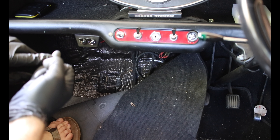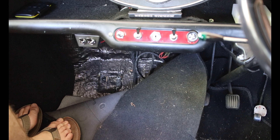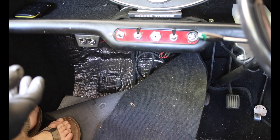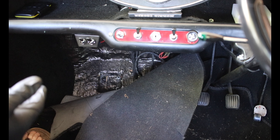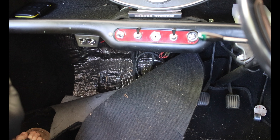Anyway, to lower that subframe, once you have it lowered and the suspension items disconnected off the ends of those wheels, all you have to do is take these U-clamps off, take the steering rack out, and put your new one in. Obviously there's a lot more steps and detail I could go into, but this is just to show you guys it's a possibility. It's extremely time consuming, and by the end of it you'll probably learn a few new choice words because it is kind of frustrating — but if you think it's important to switch the steering rack like I did, it's definitely doable. If you feel like there's something I missed, ask in the comment section below. Otherwise, check out ClassicMiniDIY.com and check back soon for the next episode of the garage remodel. Motor on!